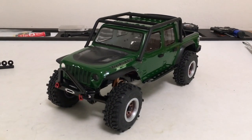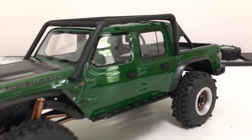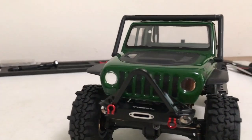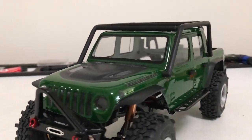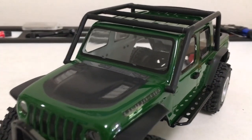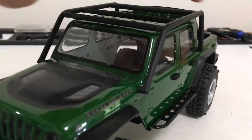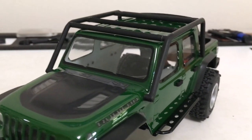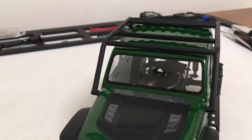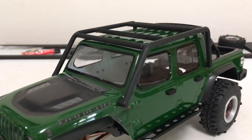We are back. Exocage installed, and that went on super smooth. Nice and level, about as good as you can get. So the way I did this rack in the end was, after I trimmed up the body mount points to fit the contours of the body, and I took quite a bit off these back ones and angled them. So I had kind of the rack together dry fitted. So I kind of stuck it on there, made sure it fit, figured out where it wanted to be.